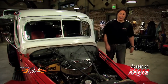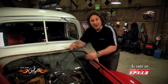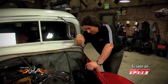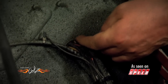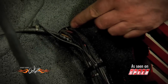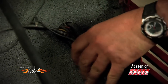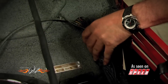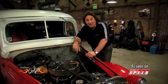Most people know that when you're building a vehicle, you should always run your wires through a rubber grommet when you come through a metal firewall, a floor, or some sort of a metal bulkhead. Something like this is a fire waiting to happen — not only is there no grommet, but there are too many wires for the size of the hole, so they're all pushed up tight against that sharp edge. Every time the engine runs, every time you hit a bump, any time there's vibration, those wires are just sawing away on that sharp edge. And eventually, you're going to have a fire if you don't fix that.